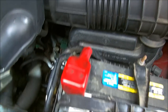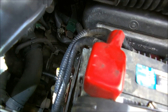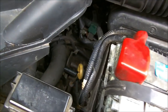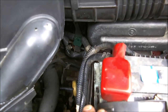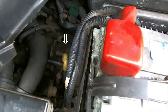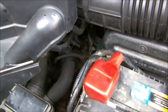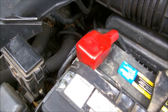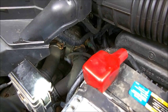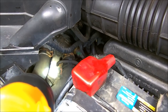One thing I did: there's a solenoid down in there. I'm shining the light on it, hopefully we can figure out where that is. If you look below the battery, there's the transmission fluid dipstick — it's right underneath that. That's one of the solenoids I already looked at a couple weeks ago; the screens were fine on that one. There's also one up in there that I have not gotten at, and I don't know if I will — that was kind of a pain.